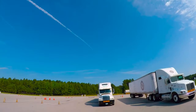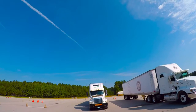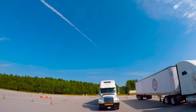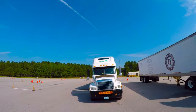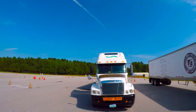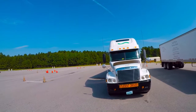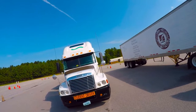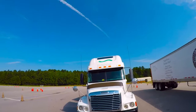The visor is not hanging loose. All my marker lights and ID lamps up there have no cracked, broken, or missing lenses. My windshield doesn't have any unauthorized stickers or anything obscuring the vision, and it looks to be clean. I can also see that I have a valid state inspection sticker. As I get closer, I'm checking the grill on the front of the truck to make sure there's nothing obstructing airflow and that it's properly attached and not broken or damaged. I can see the headlamps — no cracked, broken, or missing light lenses — and the amber turn signal indicators on the two outside edges. My license plate is valid, and my student driver sign is squarely mounted and properly attached.